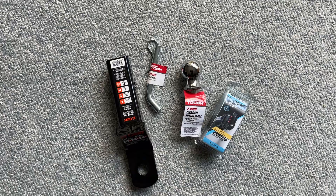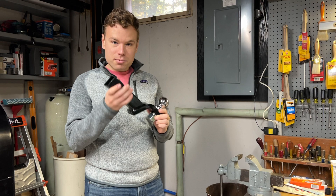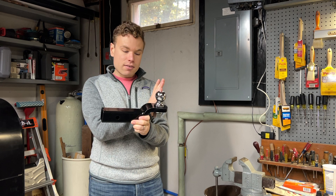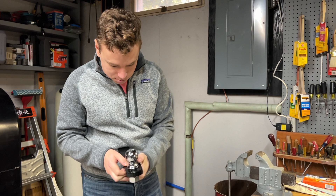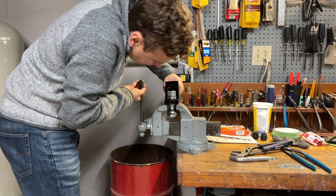We picked up a two-inch trailer hitch. You want to make sure you get one with a three-quarter inch rise. The manual says specifically it has to be a three-quarter inch rise, and the maximum distance from the pin to the ball is 8.5 inches. This is a Curt 45030 hitch — it's 7.5 inches, so it's within spec. To tighten the ball, this particular one has two flat pieces so you can get it in a vise and lock it down.